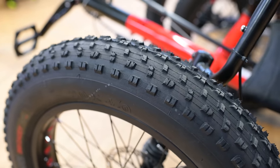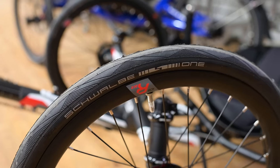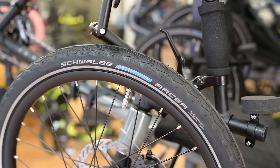Tip number three: tires. Assuming that you've got your trike aligned properly, tires can have the biggest impact on how fast your trike will roll. Every tire is a compromise though, and you will need to decide which characteristics are most important to you. Generally, a lightweight tire made with a racing rubber compound and run at a high pressure will be the fastest choice. That's why we see the 140 psi tires like the Durano and Ultrimo on racing trikes like the ICE VTX and the CatTrike 700. These tires will definitely make your trike roll faster, but they also ride rougher and don't wear as long as touring tires like the Marathon Plus. The industry standard tire is the Schwalbe Marathon racer, which tends to be the overall best compromise of speed, comfort, wear, and puncture resistance. If speed is your main concern, we are going to recommend trading those racers for a faster tire like the Durano, which can gain you two miles per hour.